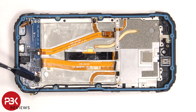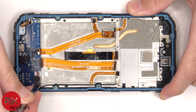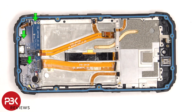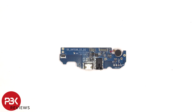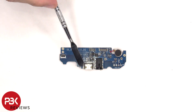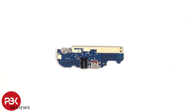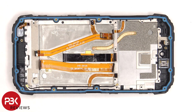The vibrator motor is located here, and the wires are soldered to the subboard with some adhesive holding it down to the frame, so it needs to be gently pried off. Now there are three Phillips screws that need to be removed. The headphone jack is located here and the charger port next to it. There's also a blue rubber gasket which goes around the frame to help keep water and debris out.